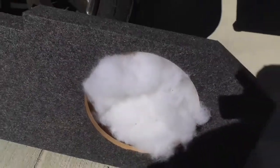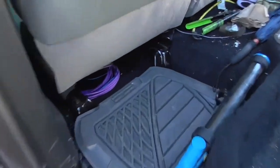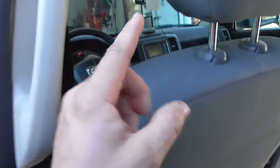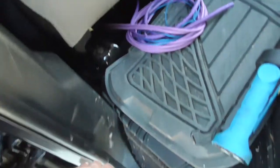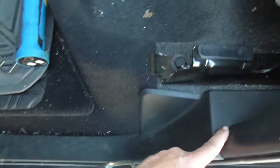The way they're designed, one side has the speaker terminals and on the other side they have the jumper harness spots to make it 2-ohm or 4-ohm. That makes it not want to fit down in this square-cut hole — you have to have the sub sideways in order to fit in the hole. I almost made a big problem for myself but it corrected itself fairly easily. Now all I have to do is mount the amp under there, run the bass knob up to the dash, take the bottom of the pillar off, and run my two speaker wires through there and along the wall.